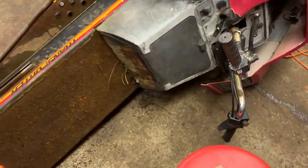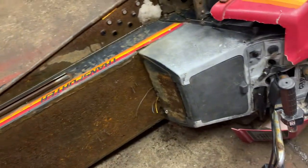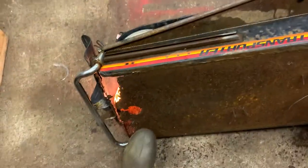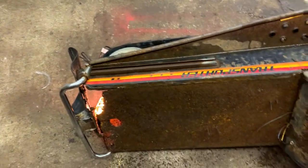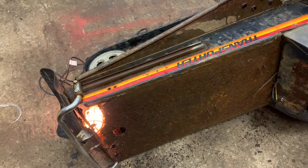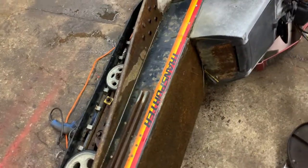I cut the tail light wires down there because I'll solder them when I put it back. You can see the tunnel on this is going to need some work — there's your flex right there. I'm thinking it's probably best to cut this out and reinforce it with some flat bar to get some structure there, then take the grinder, cut out the rot, and put some galvanized sheet metal in there, riveted in. That way I won't have to weld the galvanized because it's toxic — the zinc-plated stuff is not really good for the lungs.